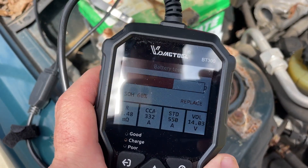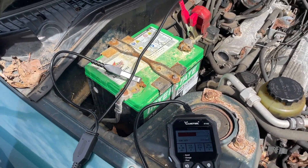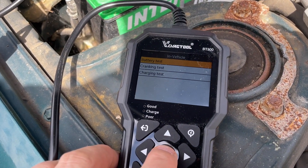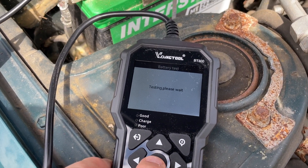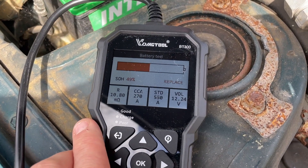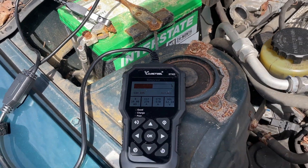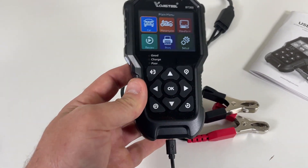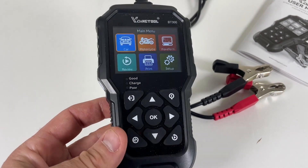This is a great tool to tell you about your overall battery health. Testing one more time with the engine off at 550 CCA — down to 49%, replace. Cold cranking amps at 270, so just sitting it's already dying. The VDIAG Tool BT300 is a great product if you need something to test batteries — highly recommend, definitely pick one up.